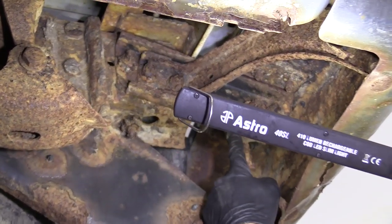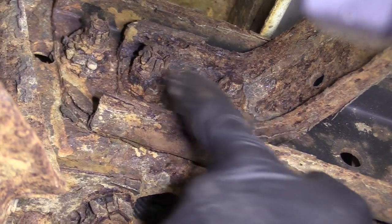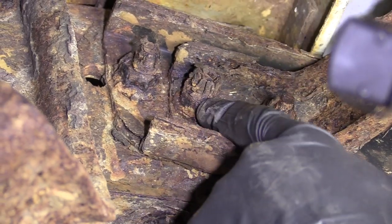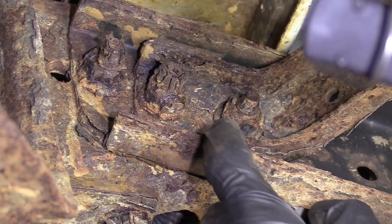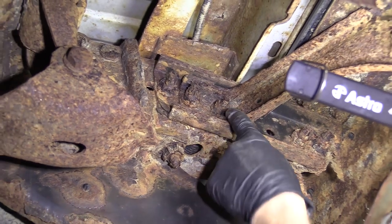We're going to replace the brackets that go with it. There should be a nut here with studs that come from this side — a nut there, there, up here. As you can tell, this is all just kind of disintegrating. So what we're going to do is get rid of all this and blast it right off with a torch. Your case may not be the same as mine — you might have some actual nuts on there that you can grab onto with sockets, in which case, good for you. I would do that.